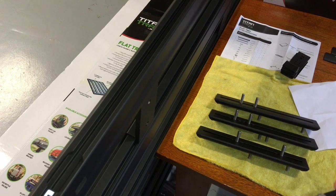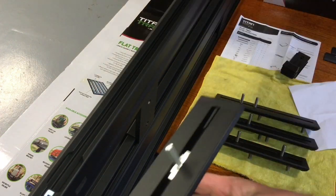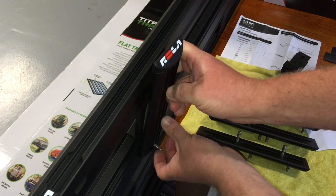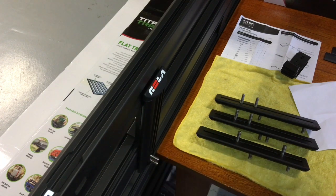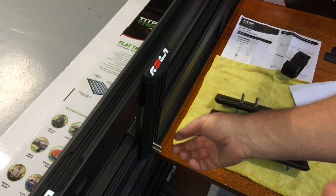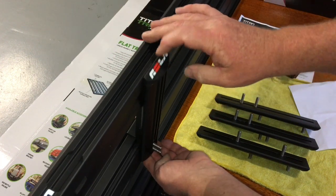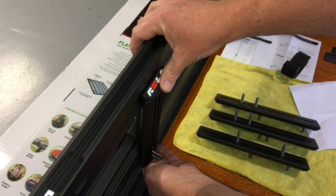So here's the tray. The way the roller faces is at the end - this is the roof side of the tray, this is the sun side. Low mounts go underneath. So what we need to do is grab two flat washers and go around there and put two flat washers, two spring washers, and two nuts - I'm going to leave everything loose, finger tight. They're really quite adjustable - it all slides, so depending how wide your roof bars are you can have it flush or go narrower.